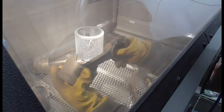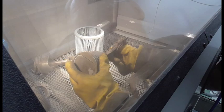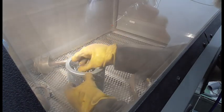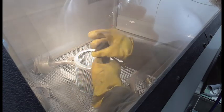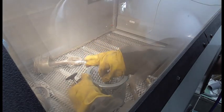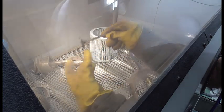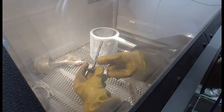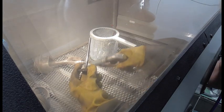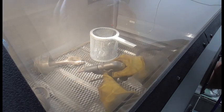The rods wouldn't matter so much. These are the rods here. That wouldn't matter so much because it's a rough surface anyway, but the heads of the pistons are smooth, so are the sides. Let me find one here that's dirty. Yeah, some of these are already cleaned up. Well, it hasn't been blasted yet. So anyway, smooth surfaces, these gloves are long, so these real smooth surfaces like this, you don't want to mar them or pit them. So glass beads don't really or shouldn't pit it.